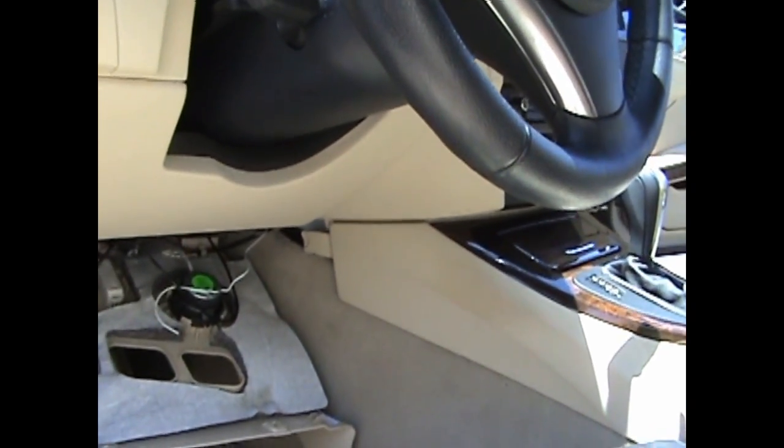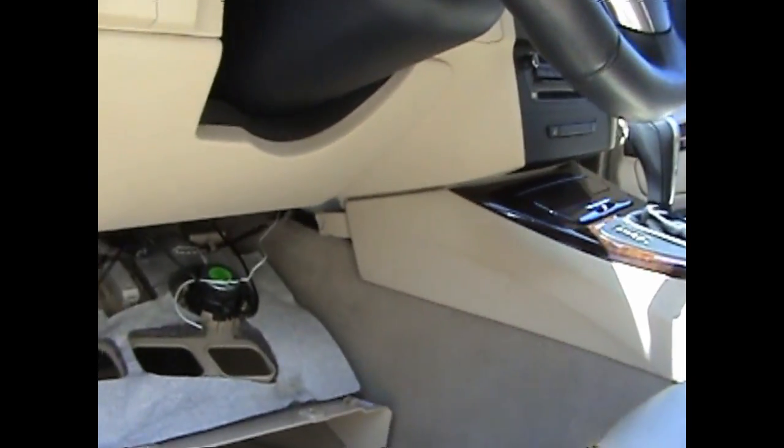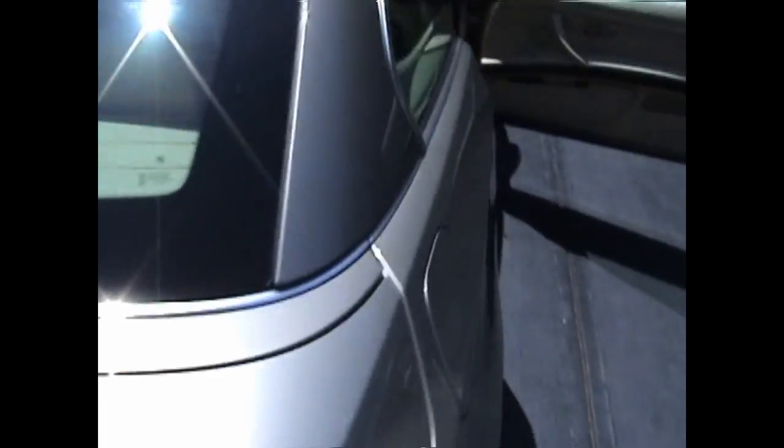The next step is to get your sensor wire across the center tunnel and over to the passenger side where your fuse box is. It's not hard — just take your sensor wire on the end of a coat hanger and run it through the back from the driver's side, up and to the back of the tunnel, push it right through and it'll come around and out on the passenger side. The panel on this side comes off with two T20 bolts. Just unscrew them, it drops down, and you put your sensor wire into the passenger compartment by opening your glove box and bringing it up and through.